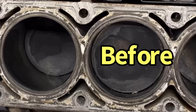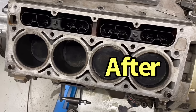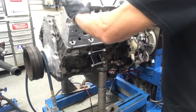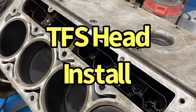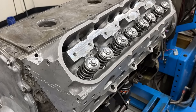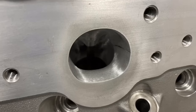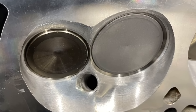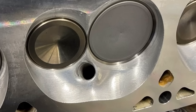Time for a little razor blade rebuild. After the Super Richie razor blade rebuild, we installed new Felpro 41,000 MLS head gaskets and installed the Trick Flow 220 as-cast heads - that were no longer as-cast - using new factory head bolts. The 220 heads featured full porting on the intake and full porting on the exhaust, as well as extensive combustion chamber work from the guys at Brian Tooley Racing. They featured a 204/157 valve package with a 50-degree exhaust valve cut, and the heads were also milled 30 thousandths to increase the static compression ratio, putting the chamber around 60cc's.